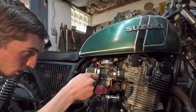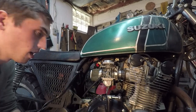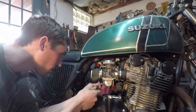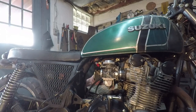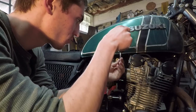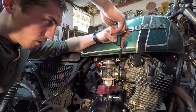Let's get to work. First things first, the air filters have to come off. If you're new to my channel, then keep watching. If you've been around for a while, you've probably seen me do this about 1,000 times by now, so you can fast forward. I give you permission. Then we've got to loosen up the hose clamps around the rubber intake manifolds.